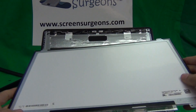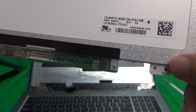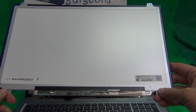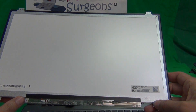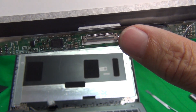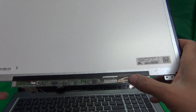This particular screen is a 15.6 inch HD EDP screen; the part number is 156WHUTPA1. There are four different screens and they all look very similar — the tabs and connector positions are the same. The only difference is that touch screens have a 40-pin connector, while both the HD and FHD non-touch screens use a 30-pin connector.